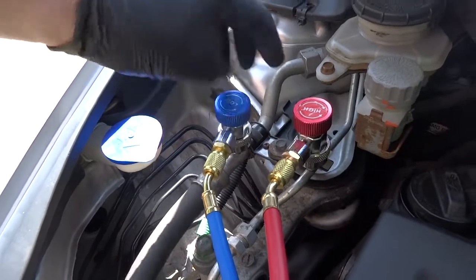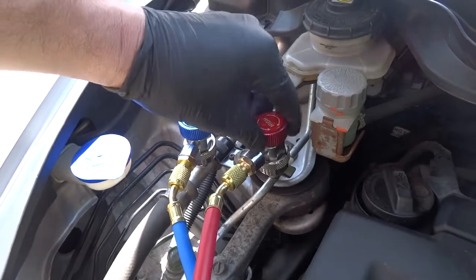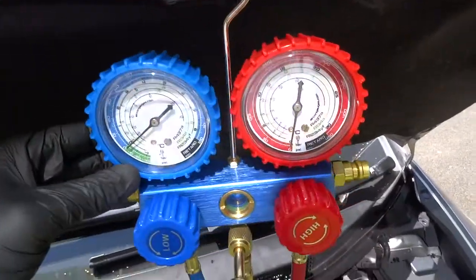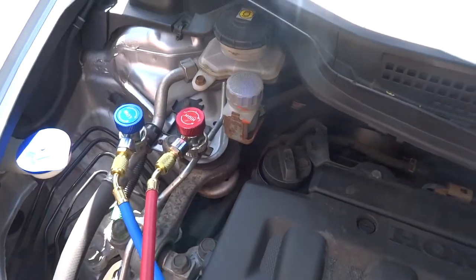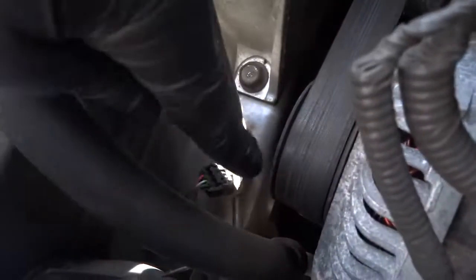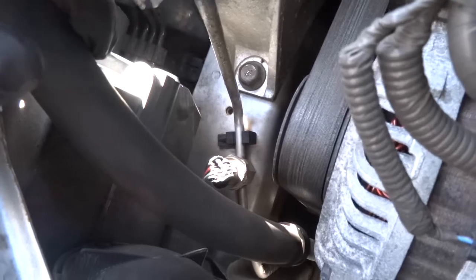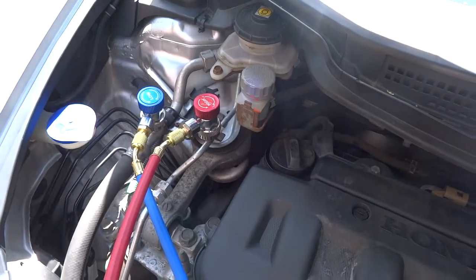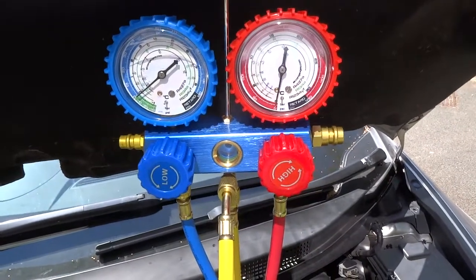So now I'm just going to turn them down. What you're doing is closing that down so it's opening the Schrader valve, and already I can tell there's nothing in this system. It's empty, so there's not really much more I can do about that. There's a leak on the system so I'll have to vacuum it down — I'll do a video on that next. There's your pressure switch just there, so obviously that's reading there's no gas and it will not allow the clutch to come on the compressor, so this system is basically dead. I'll do a vacuum test on this to see if it's leaking and then do a leak test.